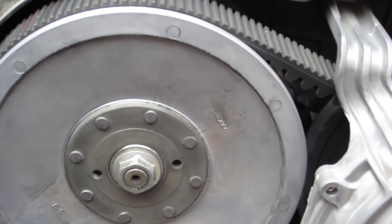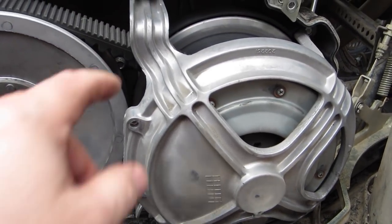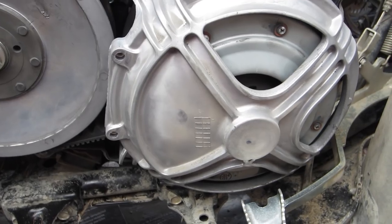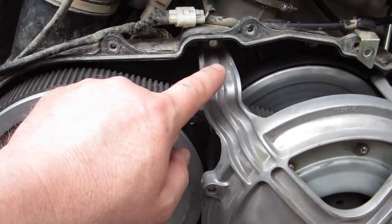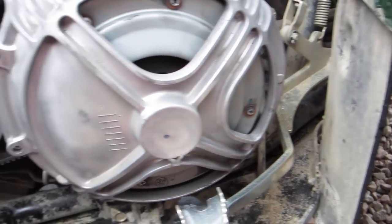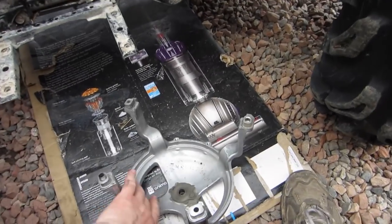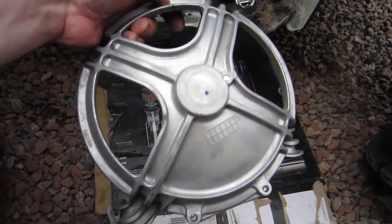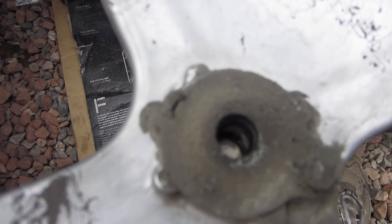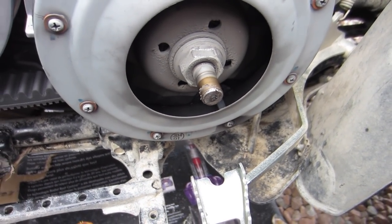I've got a new one to put on there anyways. 5,000 kilometers on the belt — I can't complain too much about that, it'll make a good spare. So now we have to take what I think they call the carrier — four bolts — up there, there, there, and there, and another one here that holds the end of the clutch up. Take those off. Now we've got that cover off — there's a little bushing or bearing in there that supports the end of the shaft. I'm gonna keep that clean, put a little grease on it after.